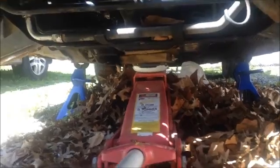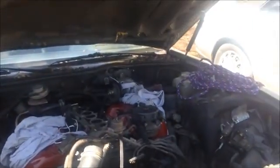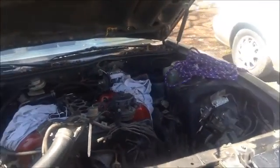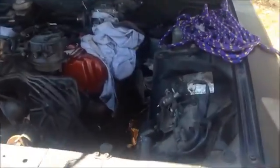The motor's up. With this swap I need to jack it up from the oil pan. Most people would say not to, and they probably are right, but since I am not using the oil pan that's already in there — I haven't switched it over yet — I don't really care if it breaks or bends it or anything. So it has enough strength to support it.